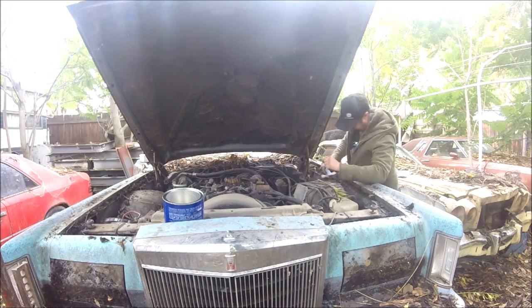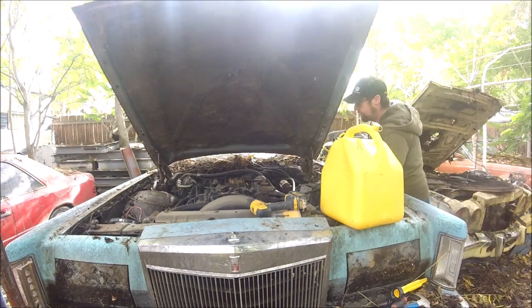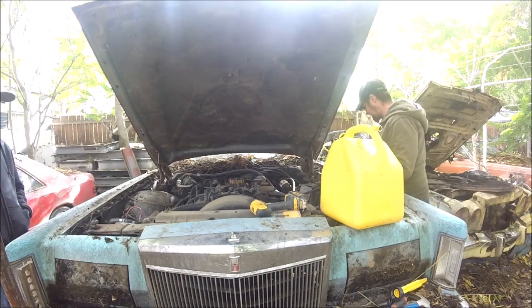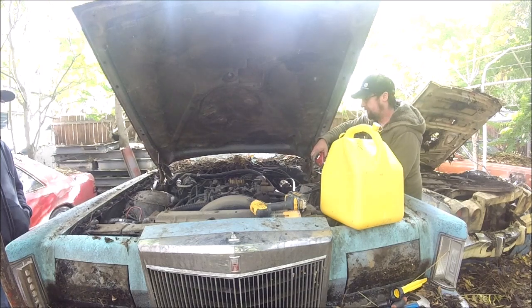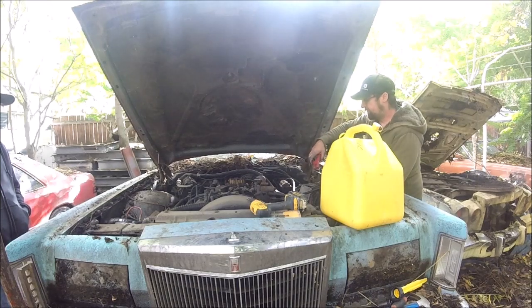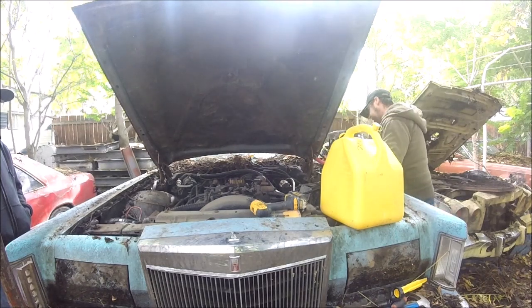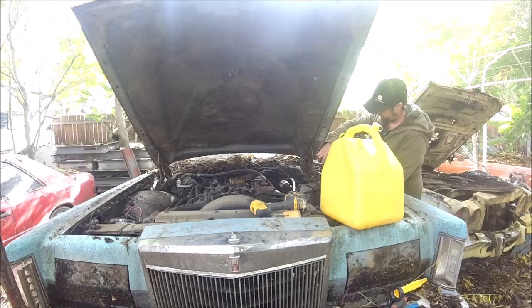No. Okay. Stop. Hey guys, we had the camera off there for a bit, but what we had going on is we figured out the fuel system's working and all that, but it's the stuff that's coming out of that tank. I mean, it smells more like water than fuel, and we've tried pouring some of it right down the carb, it won't even light off with that. So we've plugged off the main fuel system and we've rigged up another one here with a little clickety-clack electric pump, and we're gonna try and fire it off on this and see what happens. We're gonna have to dump that primer in there.